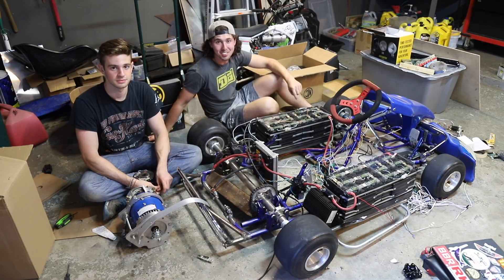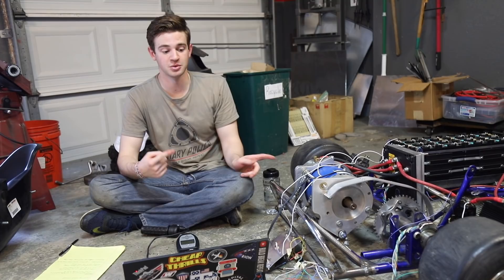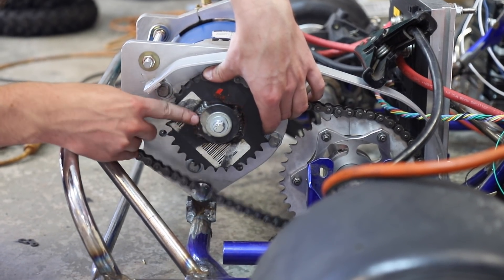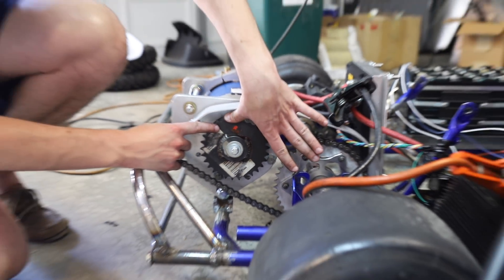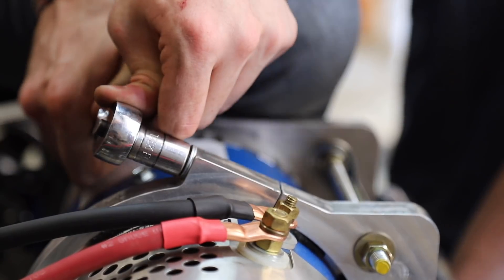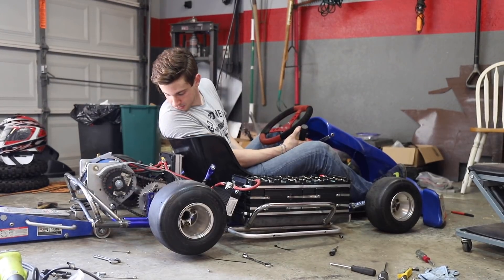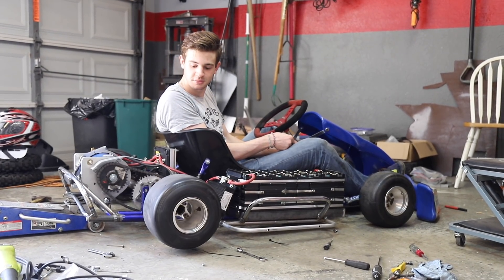In the last video we got this thing finally running. As you can see, there's wires everywhere and a lot of work to do, but there's really not that much left between us and a bunch of electric power. We're getting the chain on. I also bolted this sprocket up and got our keyway matched up. We've never really messed with electric stuff, but this is going to be a pretty good reduction — I think we're going to be able to go pretty fast. Everything is completely ready besides our throttle, but right now we just want to test it, make sure everything's working, test if the chain's alright. It's on — contactor — this is forward.